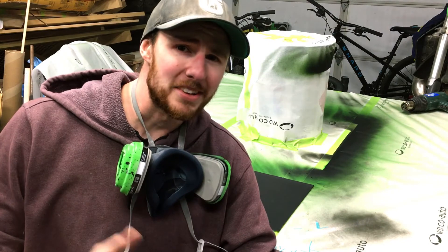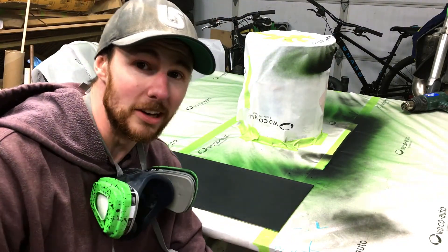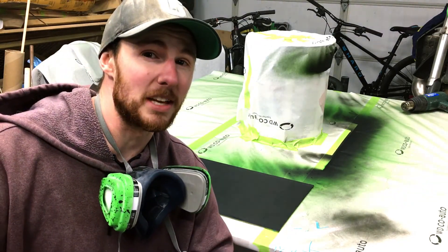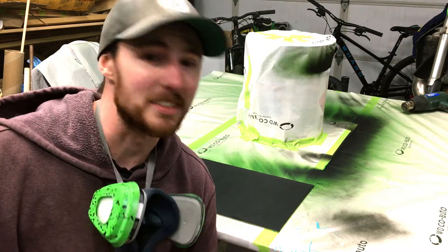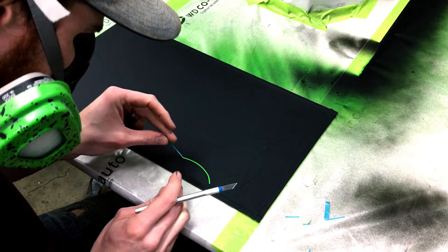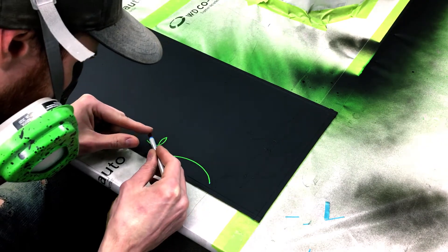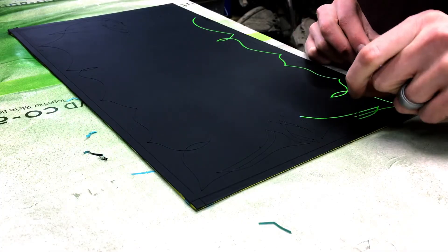I like to unmask while everything's still a little bit fresh — dry to the touch but not completely cured, after about five minutes of flashing off. We're going to take off the masking tape right now while everything's still a little bit soft. For peeling off my fine line, I like to use an X-Acto knife with a nice tip to just get under the edge of the fine line, then use the pressure of my finger against the blade to lift everything off. Once it's far enough that I'm not going to touch my panel, I'll grab it with two fingers and pull it away.